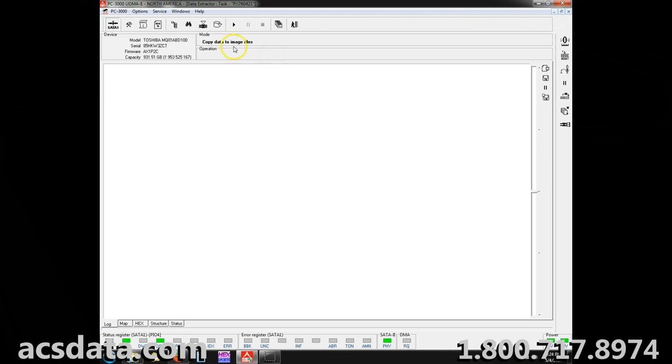So now what we can do is go up here to the Explorer. We could go through and generate a head map for it. I'm not even going to waste the time doing that right now. I already know that the heads are good, and yes, I know that there's going to be areas that aren't readable, but if we can't read the front end of this drive and see the partitions and be able to scan the MFT, it's really not going to matter. So